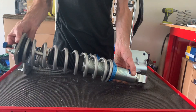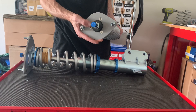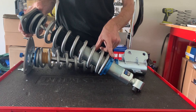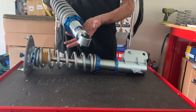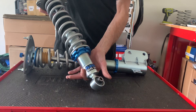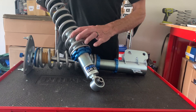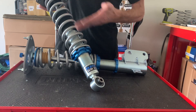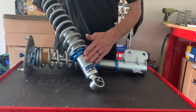So this is a rear unit. One thing we've changed is on the top — it now has a rubber bushing instead of the spherical bearing, so it's going to be a lot quieter. It's got a longer main spring here. The other big change is no more adjustable lower mount, so it's a fixed position height assembly. You just set your ride height by adding preload. This collar here, as you spin it, puts pressure on the spring going upward. It keeps it from compressing more, or it counters the natural sag that a spring is going to have, giving you your height back.